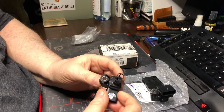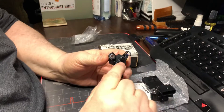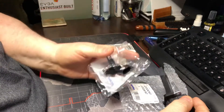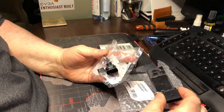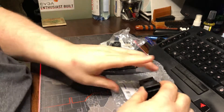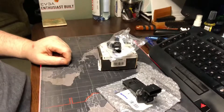If your diesel is running rough, idling rough, something's wrong, or it's using more fuel than it should — all these little things connect to your ECM, and your ECM is what controls your fuel flow. A lot of times the problem may go on for a while until these things completely stop and then they throw a code. They're very simple to replace — two bolts, put them in, one bolt for that one. Just make sure that if they have an O-ring, you replace it. This is Frosty, guys, and I appreciate you watching.